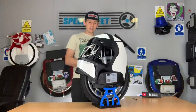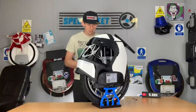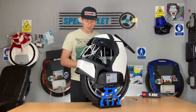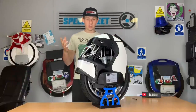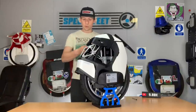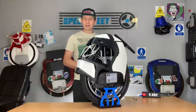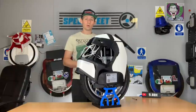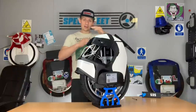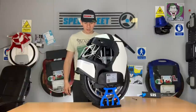This area here - the struts - as you might see in this video, has a bit of oil on it for lubrication to make sure it all runs smoothly. That means it's going to be a magnet for dust. There's no cover or protection on it. Just like a full suspension mountain bike, you have to keep that clean. Don't pressure wash it. A wet wipe or rag will do, and we'll also be selling suspension lubricant on the site - you drop some on there and as it goes up and down it pulls it in and keeps it clean.